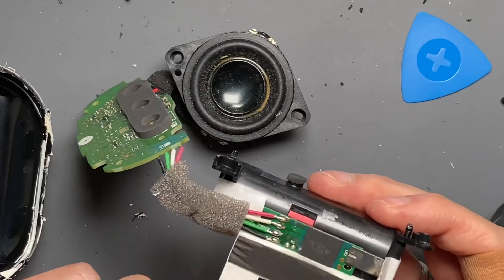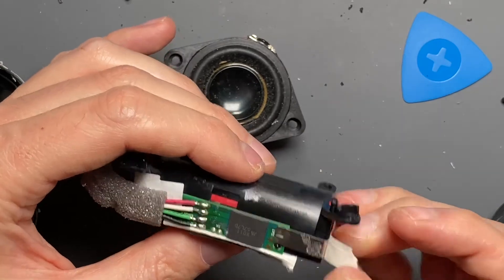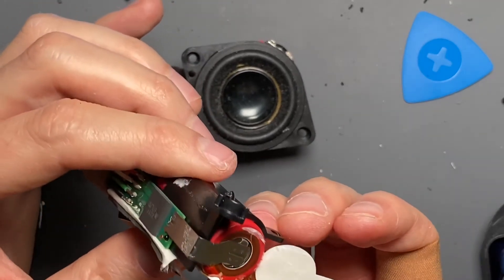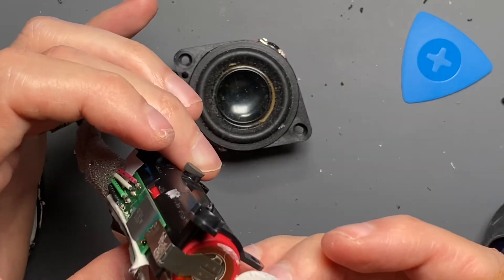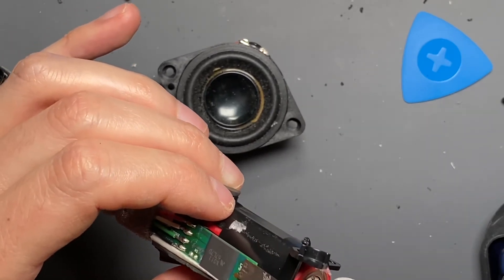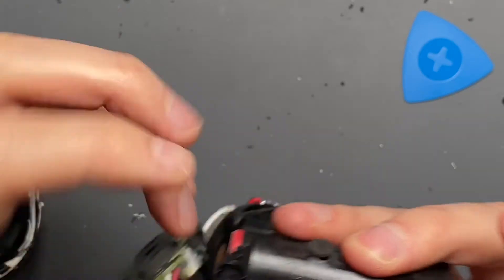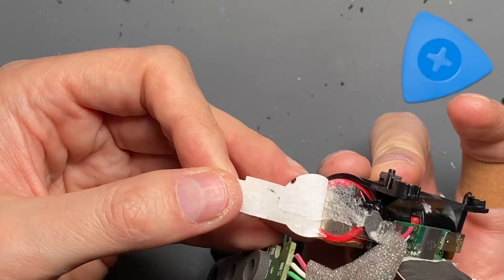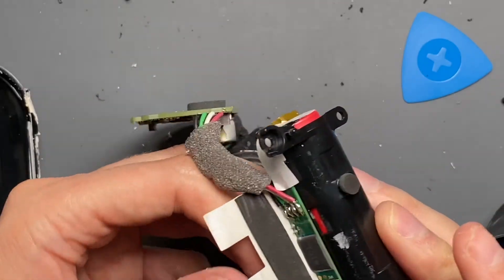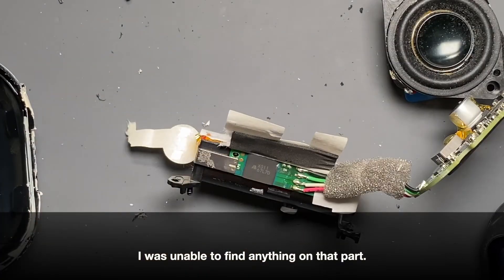There's a tab — wow. It looks like an electronic fuse. The tab is tack welded. The cell is tack welded. Someone makes this assembly for Bose — or Bose makes the assembly. Actually, you can get cells with tabs on them and then just bend and solder this thing back together. It's spot welded on both sides. That's what this board is — I think it's battery protection, though it's not a typical battery protection circuit. I think there's also a thermistor that's embedded, being reported via the TH silkscreen marking I see at the top.